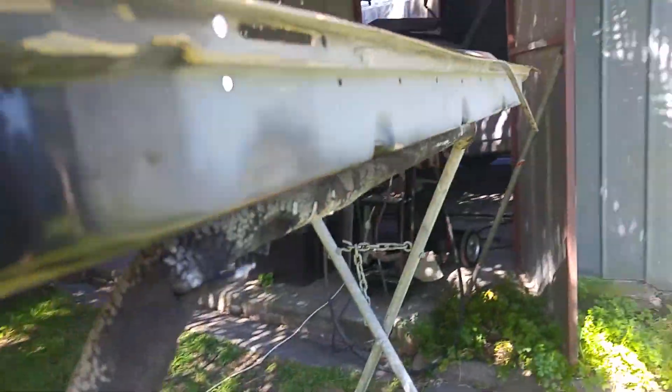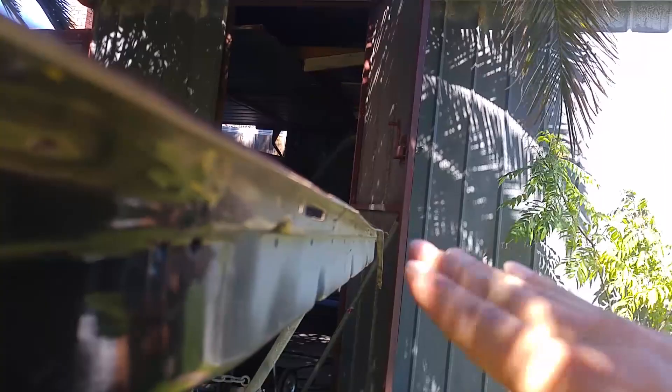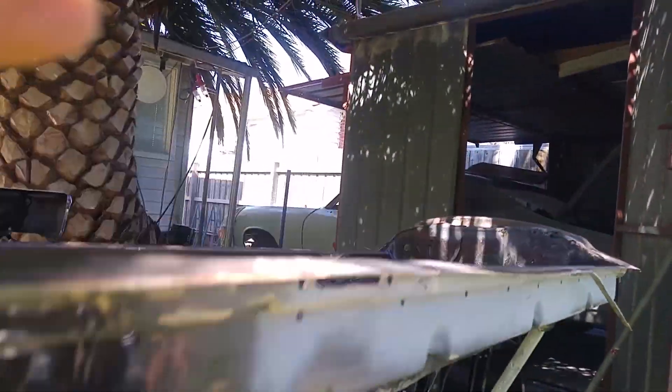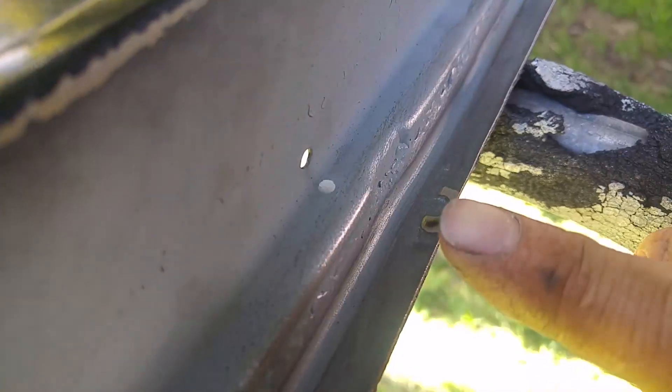There's a problem across the bottom of the frame. I'm either going to have to straighten that, or expect the door skin to straighten the frame as I'm folding the lip over — which is not ideal.